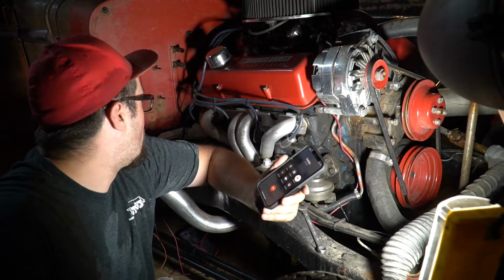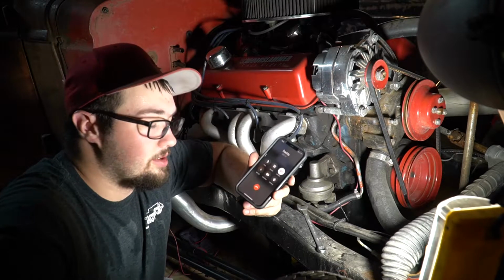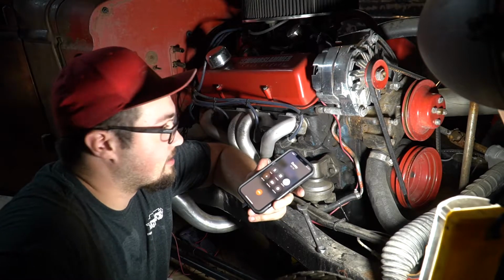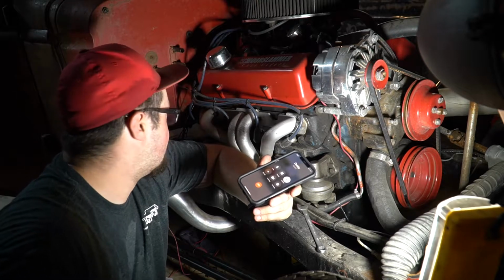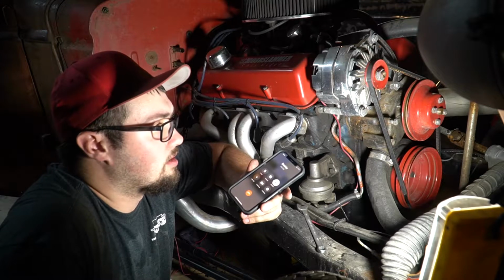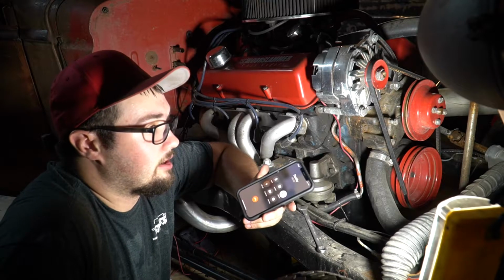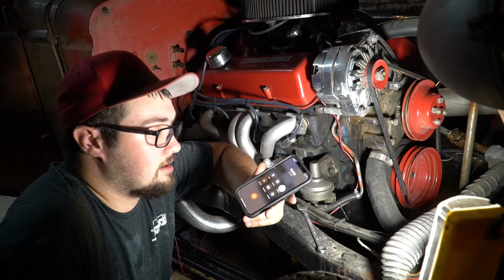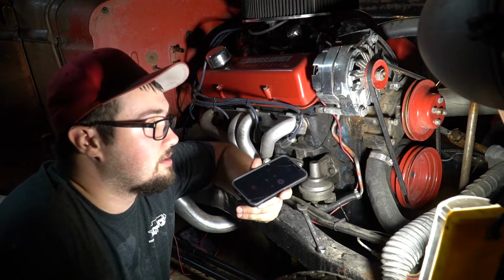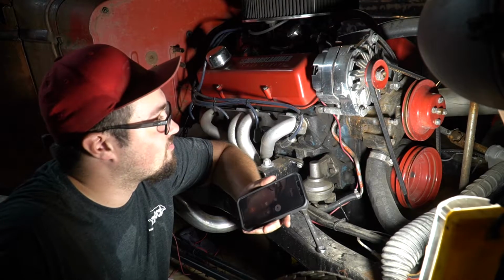So I am wiring the street rod, and I just want to make sure I'm doing it correctly, because I want to run it through the fuse box. We had talked earlier, and I just want to double check everything's correct. I have three things I need to run off the ignition switch: the fan, the coil, and the fuel pump. And so you said to run relays on each one of those, and have the main power wire coming off a different terminal on the fuse box, correct? Correct. So each one of them is going to be fused separately. Okay, awesome. Sounds good, Dale. I think that's what I'll do. Thanks, Dad. Bye.